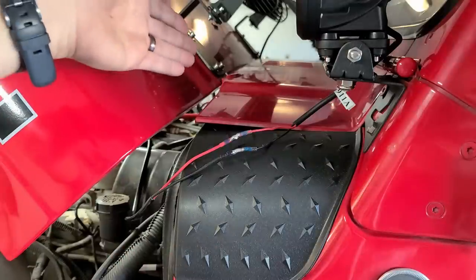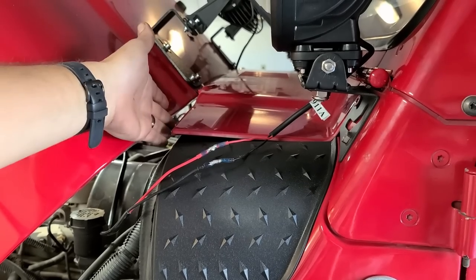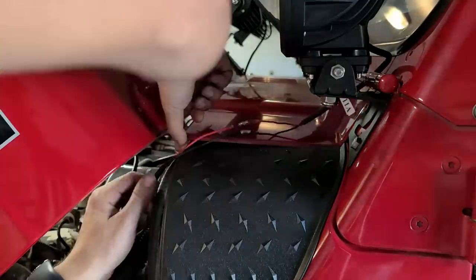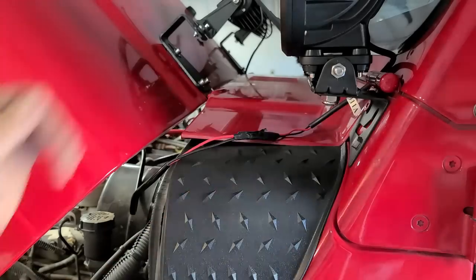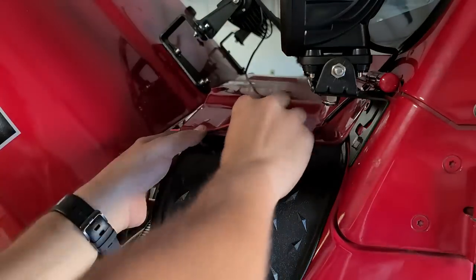The cowl is held in with about 6 screws. You could see most of them on the outside, but there are 2, one on each side over here. You have to open the hood to get to them. They are held in with Phillips. So let's tuck this in. First, I'll put some electrical tape around it actually. I've read that you wanna avoid manipulating these when they are warm because the solder is still really warm. So I will just barely snake it in.